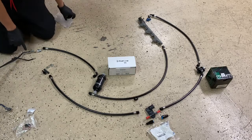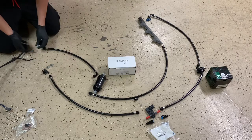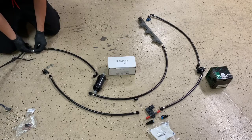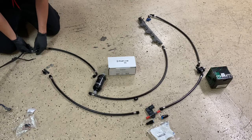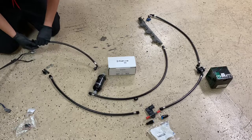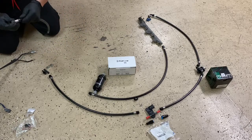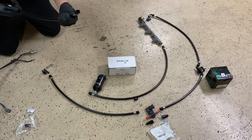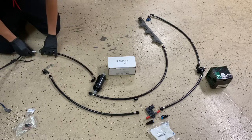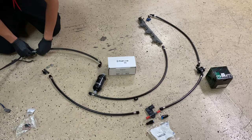This is the line for the fuel pump. Here's the fitting that I have — I do sell all this stuff on my Instagram. You put that on here tight. And here's my custom PTFE line — stainless steel inside with a vinyl wrap outside. It is made for ethanol E85.